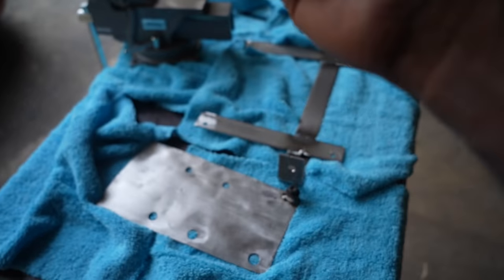Okay, next, get your multimeter and turn it on by putting it to DC volts and set it at 20, like that. First we have to check the battery, how many volts the battery is producing. So you get your red terminal, put it on the red side of the battery, and then this one, put it to the black, negative side. We are reading 12 volts, 12.65, that's what we are reading.